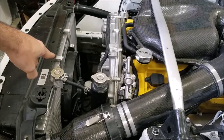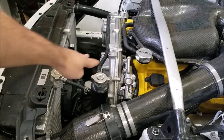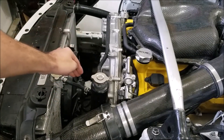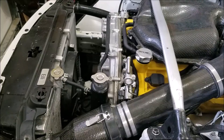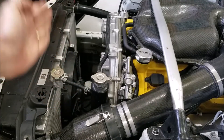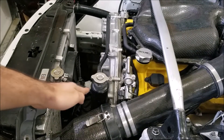Here's what's hiding under that hood vent. You can see the radiator right here up front and my 14-inch fan — just for when I'm sitting in the paddock or in traffic on the way to the track. There's not a whole lot of room between the radiator and the front of the engine, so all that air comes straight in, hits the front of the engine, and has to find its way up out of that hood. Ideally, in something like a GT car, the engine is moved back considerably and the radiator is at an angle — maybe 45 degrees — which is something I plan to do in the future.